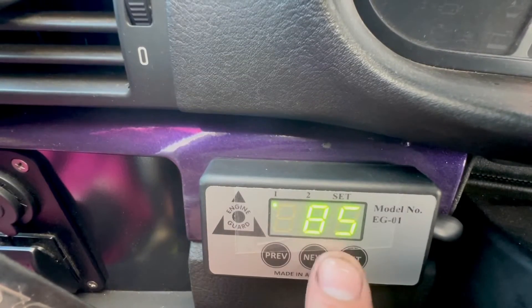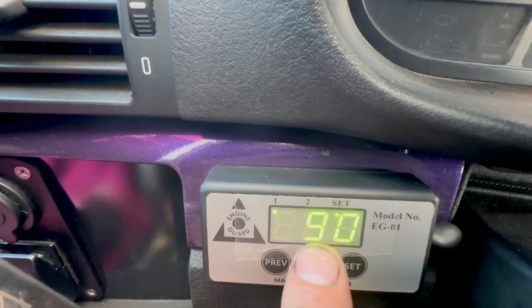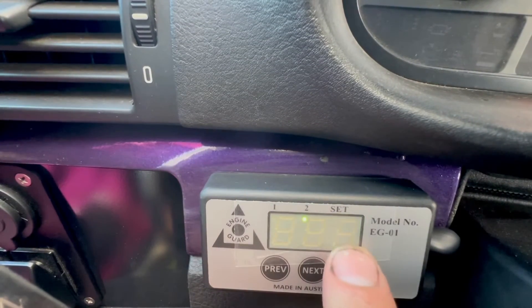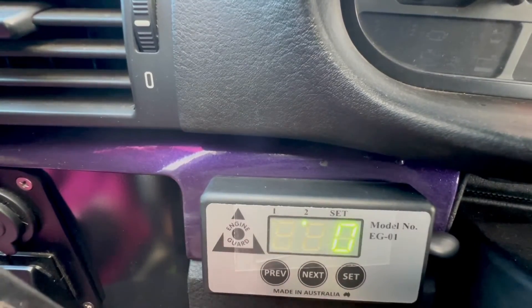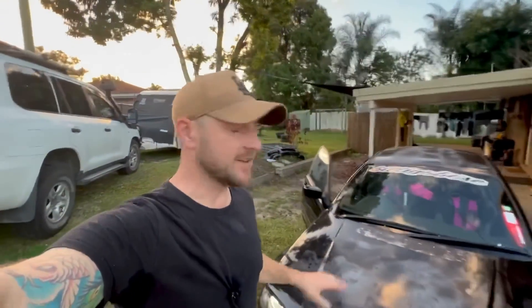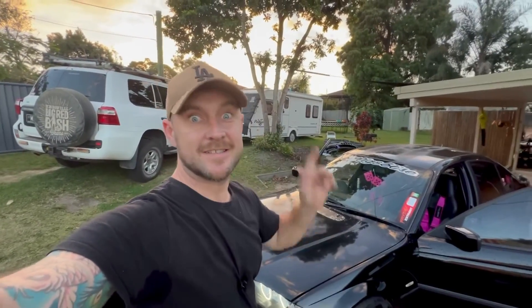You can hit set to mute it but it still flashes. The average operating temp was 85 degrees, and per the instructions we set it to 5 degrees over — so it's set to alarm at 90 degrees. The next setting is for the oil pressure switch — if it reads zero, it will alarm, which makes sense. That gives me a lot more confidence. It's probably about half a day's work — takes me a full day because I've got to film everything. Definitely worth it. I'll put a link to the engine guard in the description.